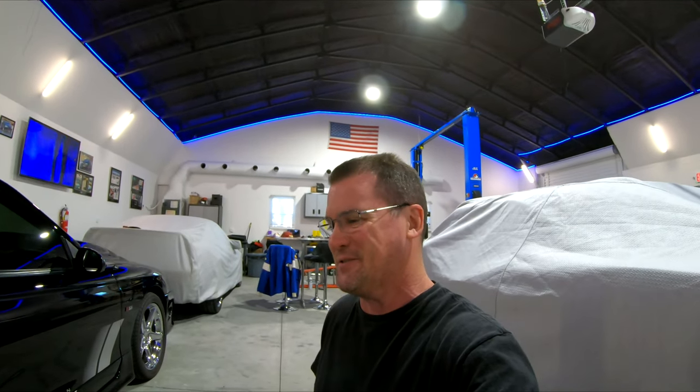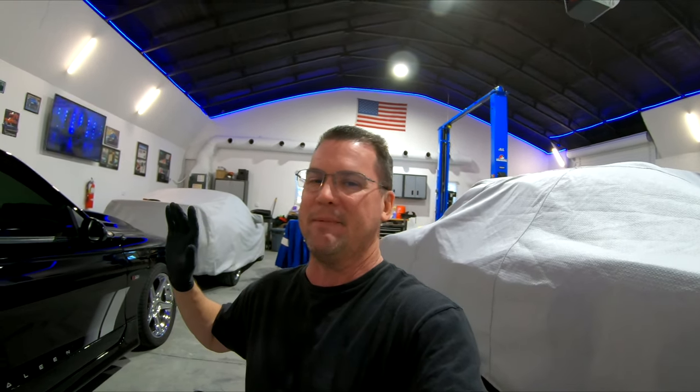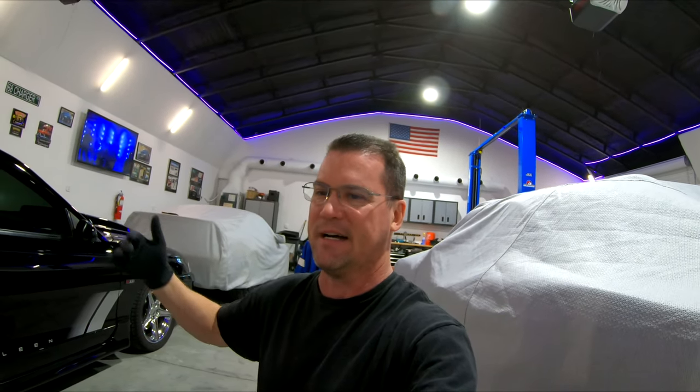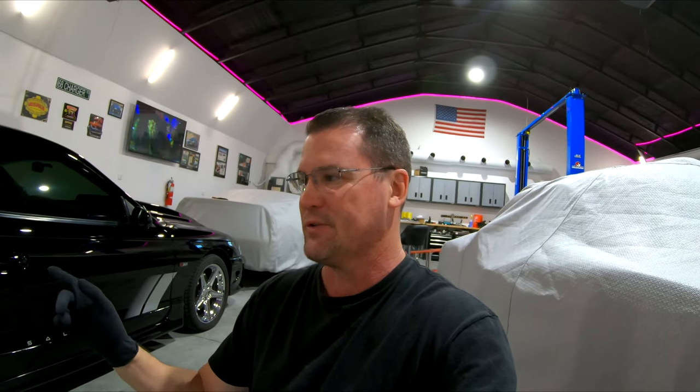Now everybody does it — it's actually easy these days, which is hilarious how far technology has come. This new Holley computer makes the tuning so much easier. With the timing and E85, it does spool noticeably better. I still run a 3.27 gear in the back from when I had the 6R80, but I should probably go to at least a 3.55 or maybe a 3.73 with this T56 Magnum, because first gear has a very long ratio. A 3.55 would make a noticeable improvement, and when I eventually go to a Turbo 400 later, that 3.55 would be a great all-around gear. The ring gear is definitely noisy — I think I've just beat on it with the power and weight — so I need to change the ring and pinion out, but right now it's just getting it all cleaned up.